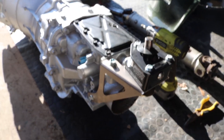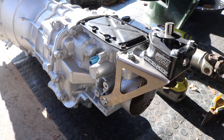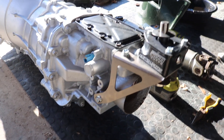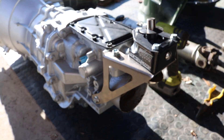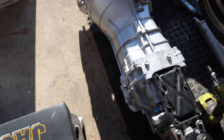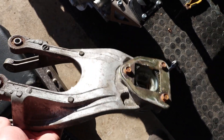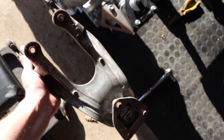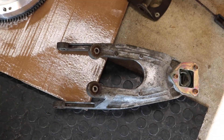For my setup on the CD009 I'm using a Serial 9 shifter. I'm not sponsored by these guys in any way — I just really like the product. It was recommended to me by a friend who said don't do anything other than this, you'd be wasting your time. It's definitely not cheap, but with the amount of issues I hear other people having with other brand shifters, I think it's hopefully going to end up being worth the money. The factory bracket brings the shifter point back quite a bit — obviously in an S30 you don't want that — which is why I went with the Serial 9 shifter.